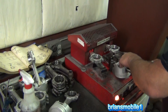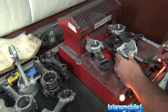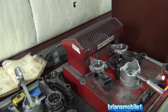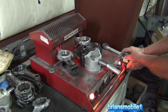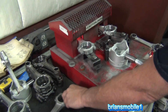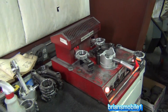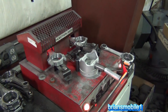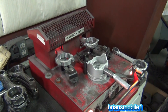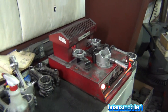Here we're getting some pistons and rods put together. He's got a certain jig, and he's also heating them — the heat causes them to expand, which allows you to put things together. Once they cool down they're nice and tight. Some are free-floating and some are a pressed fit. The free-floating rods will have a bushing in them and you can just clip those on — that's like your Subarus and a lot of the foreign cars.